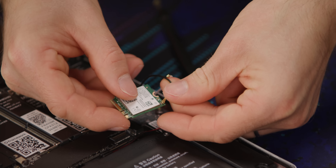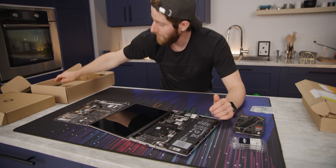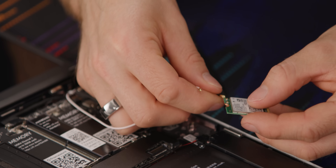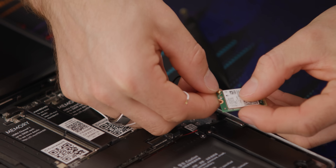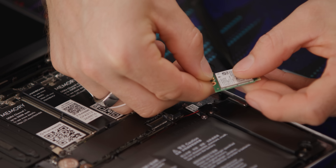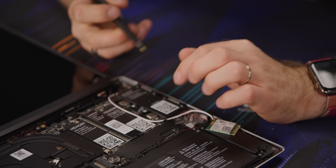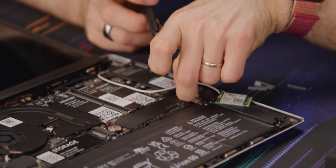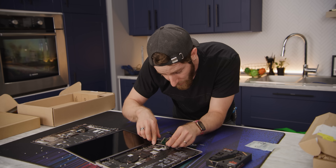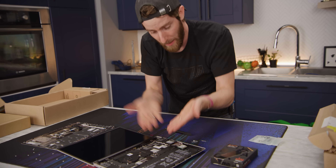Here's a little mini PCI Express slot. Conveniently, the screw is already in place. Be really careful with these — especially if you have to take them off and put them back on — because you can actually rip them off the solder pads. I love all the little cable management. If I ever had to replace the display, for example, this would be so easy to rerun because they've got just these little rubber grommet things. Boom, I have now re-cable-managed it. It took that long.